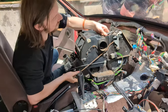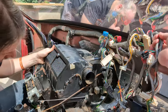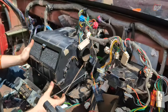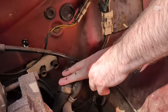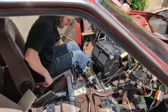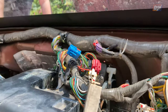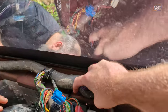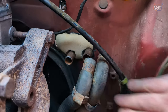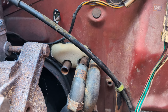Here is the big heater box just about to go in. Getting everything slotted in is no joke — there's a lot going on in here. The actual thing I need to line up is that screw hole into the body. So that's now basically in place, and these pipes have ended up right down at the bottom of this little cutout. We just need to transfer these holes onto our new Dynamat that we can put on the firewall on each side, get all the hoses back connected up, and then bolt that heater box in properly.